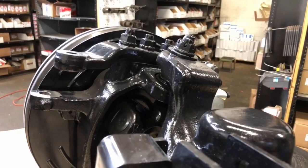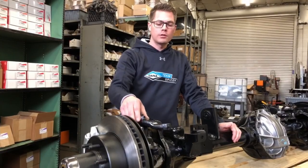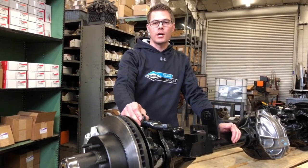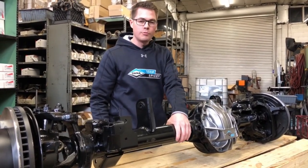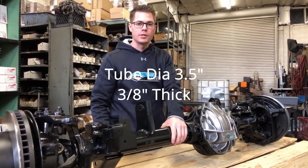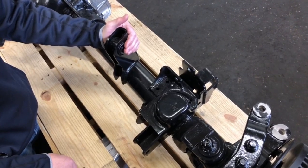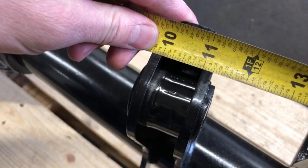The knuckle design is cast and bolted into the steering knuckle itself — it's a very solid, strong design. The axle tube diameter is three and a half inches and the wall thickness is three-eighths inch. All of the axle brackets on the Ultimate 60 axle are made from quarter inch plate.